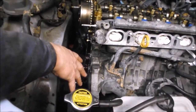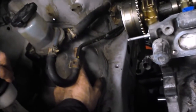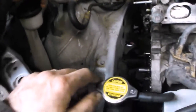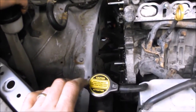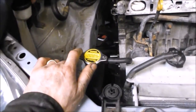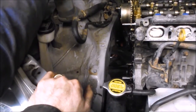There's a big motor mount here as well, and you've got to support the engine from underneath. One gotcha for the motor mount — we didn't have the best lighting and there was a third bolt hidden up underneath the power steering reservoir. Just make sure you get all three bolts from that motor mount. We spent a lot of time wondering, do we really have to take the alternator off? Yes, you do. The water pump? Yes. The power steering pump? Yes. Don't waste time staring at it — just take all of those things off and the cover will come off much easier.